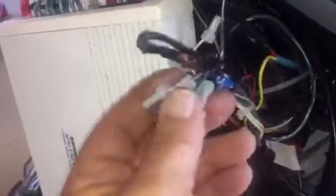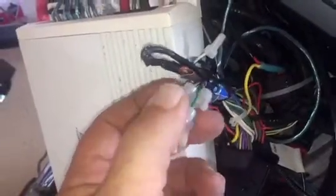Alright, before I go even further, this wire and harness was already in my bike because I did have another Kenwood radio in there. Now it looks like a big mess, but trust me, it's simple. See all these caps on here I put on? These are not being used. These are all my speaker wires coming out of the radio. I'm not using them because I'm using amplifiers, so I'm just using my RCA cables, and you could see that right here.